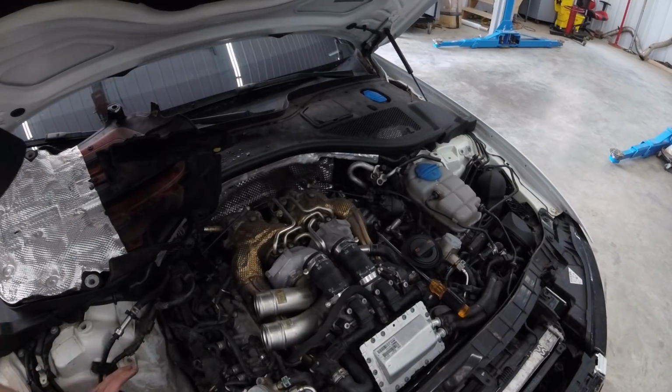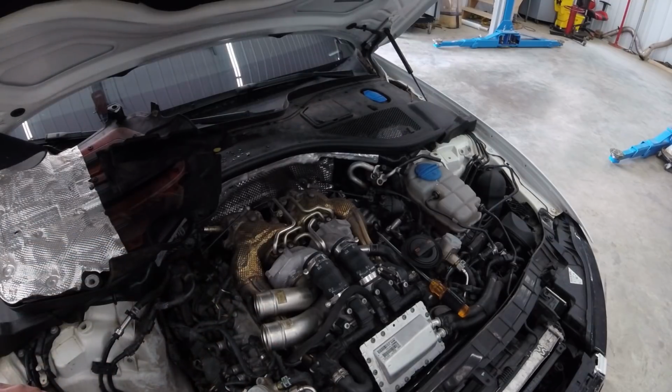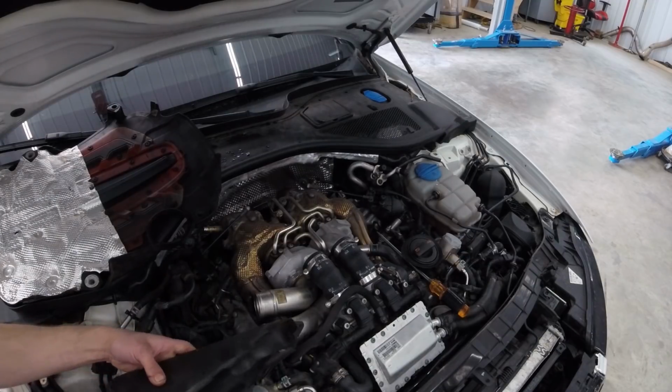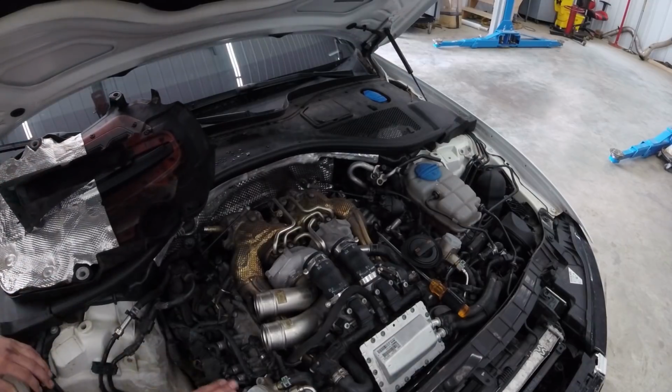Right, so airbox out. That is a very, very simple procedure. It's just basically set in here, 2 clamps here, you can pull that out. You got bolts in here that let this little scoop come out. Sitting in here, you can see here and here. Mine is missing one, so I only had one here. That wiggles out of there, and now we have our wiring harness exposed.